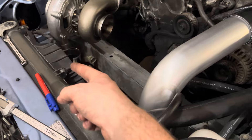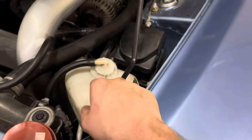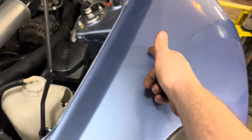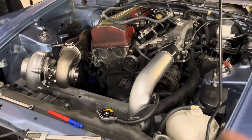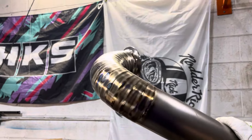Kind of in prep for a new radiator — I'm going to get an aluminum one and reverse-mount the fans so they're in the front instead of the back. Then I'm going to build a coolant reservoir, move the cruise control into this fender, and put a catch can right here at the front of the valve cover. So really not too much left — I'd say I'm about 90% done with fabrication work.